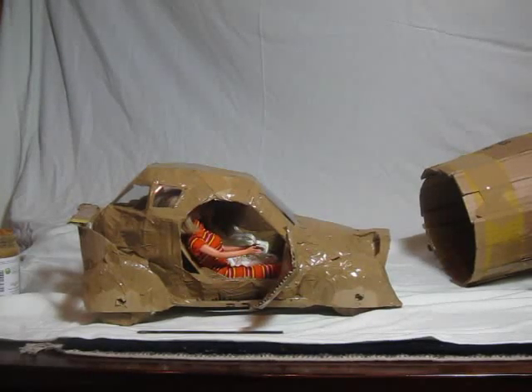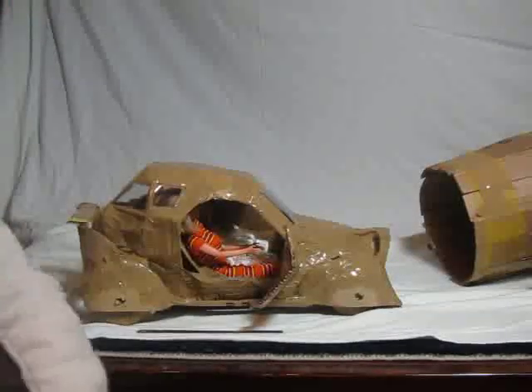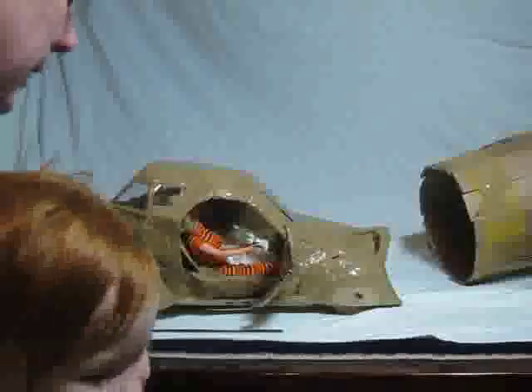Welcome to my little assistant helping with the electric vehicle. This is bodywork for a hybrid electric vehicle — it's going to be a category L7e, which is 350 kilos in weight and 15 kilowatt power source. It's designed as a three-seater.